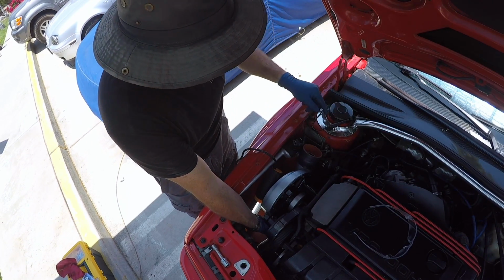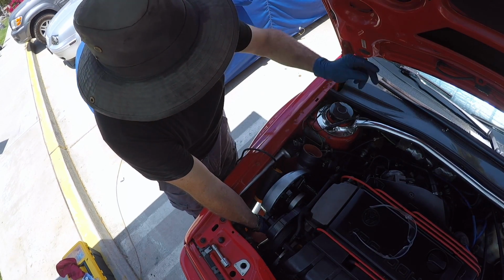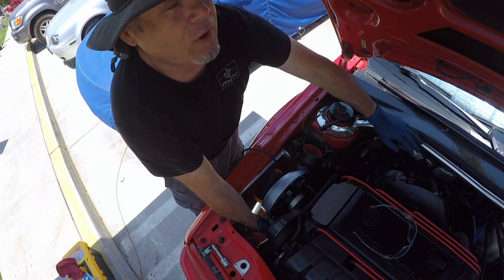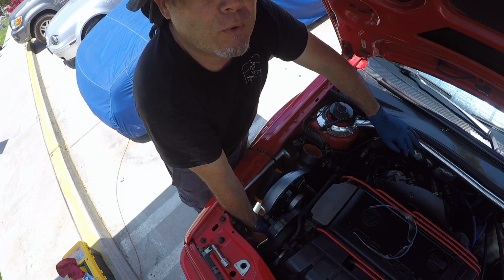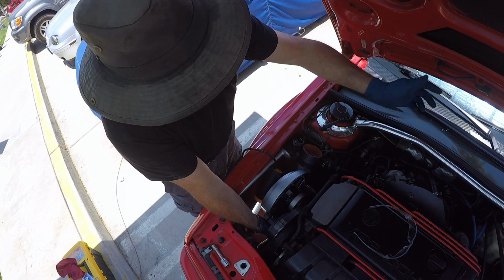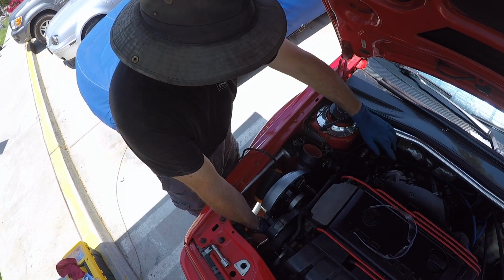Now, I did do some stuff like I broke this ABS connector. I had to fix that. The one-way check valve that needs to go to the carbon canister broke while I was installing that, so I had to order another one. So that's gonna delay finishing this. So that should be pretty accessible before I put on the final intake pipe.